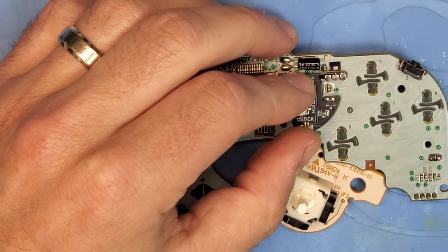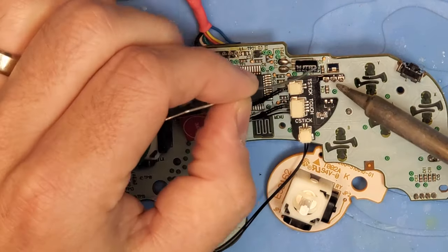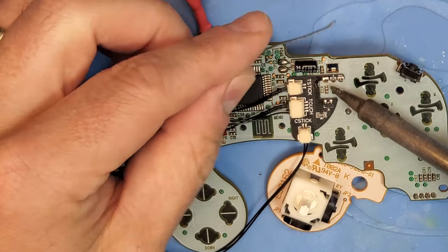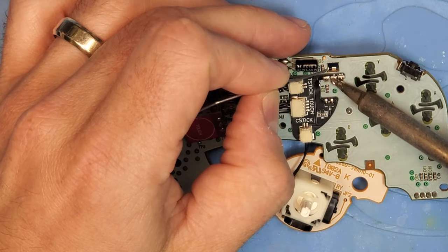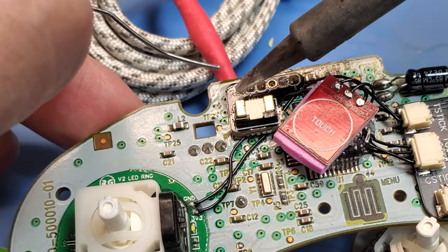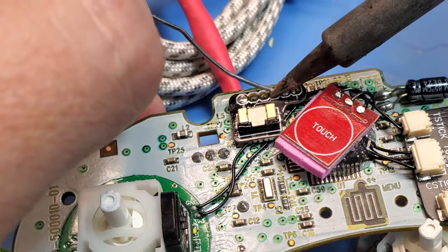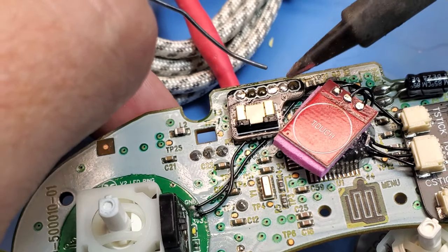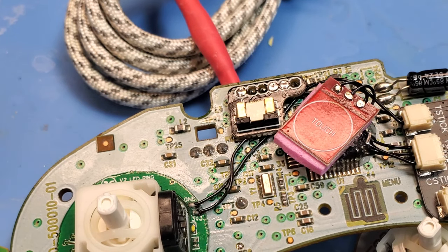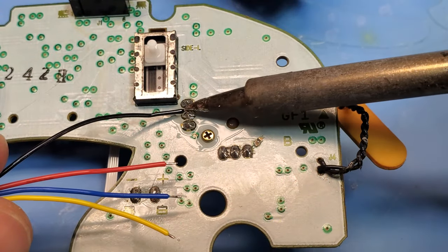As I previously mentioned, this is going to be a showcase to show off some of the different mods I've done over time, starting with LED rings. I haven't had these in stock in a while but I'm working on making more kits. Basically it allows you to light up your thumbsticks and control the on/off functionality through a touch sensor. Next, I'm going to install a ShineWave — a reactive LED mod. I'm going to use Young Link because that's who I main most of the time. Once the QSB is installed for the ShineWave, I'll turn my attention to a no-reset snapback mod. Check out the cards in the upper right-hand corner for full installation videos on any of these.